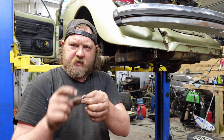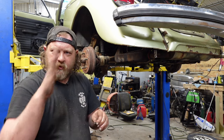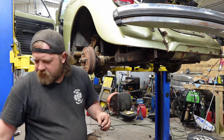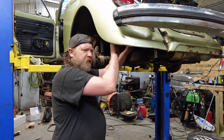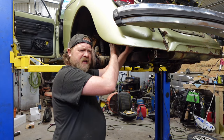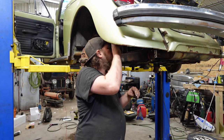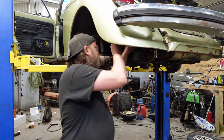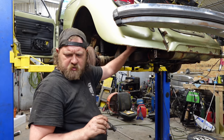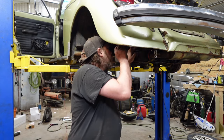Like I said, the flat, the thing that contacts the valve, it's fine. If it was cracked or rounded or worn weird, I wouldn't be doing this because I do have others. But if it's just this part, I'm not going to give up good stock for something that's not technically bad. To me, it just makes no sense. You guys might do whatever you want, but I have technology, and that allows me to cheat the system. So I'm not bound by having to constantly replace parts. If I can mildly fix them, I can fix them.